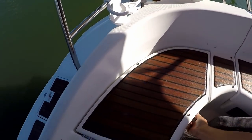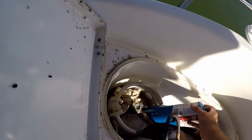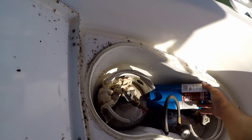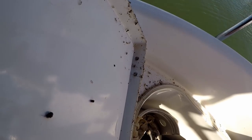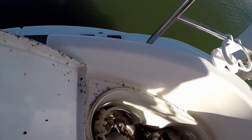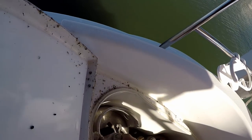On this side you've got two propane tanks, and I keep extra propane for the grill in here. The propane relay has been disconnected — I've got to hook that back up. When I turn it on it gets really hot and doesn't flip the relay; the solenoid doesn't work. All it does is get so hot you can't hardly touch it. Somebody tried putting a rag around it and some electrical tape.